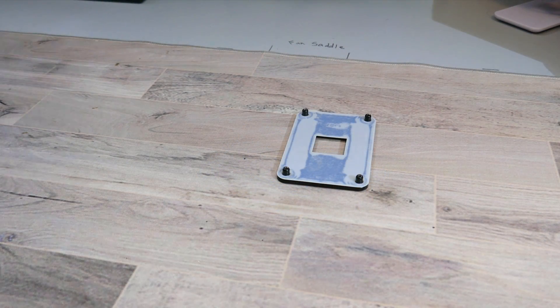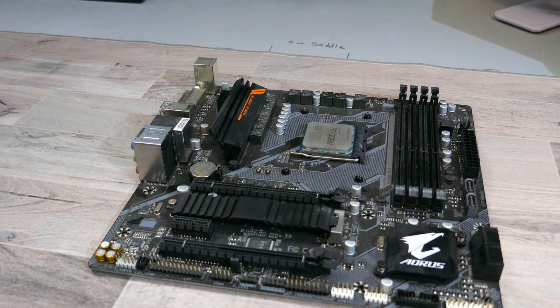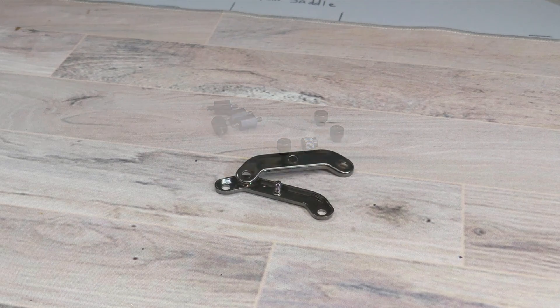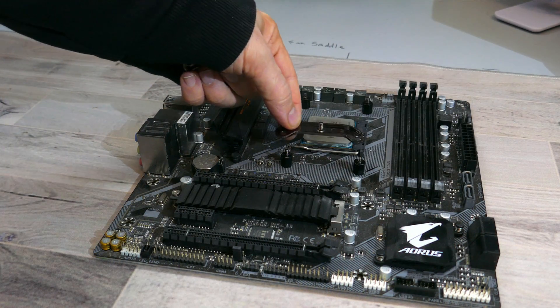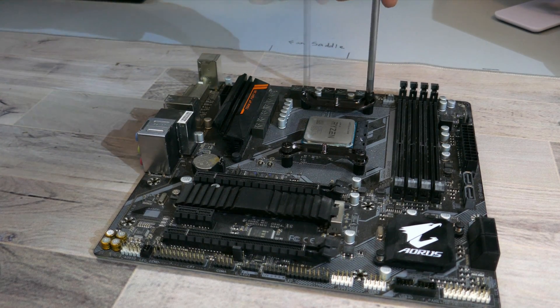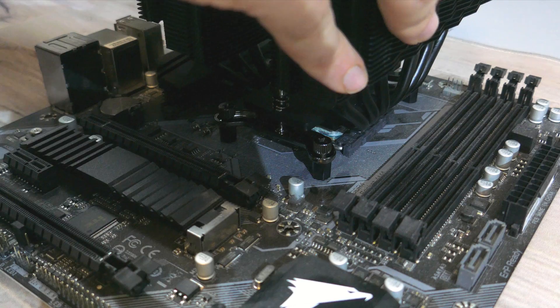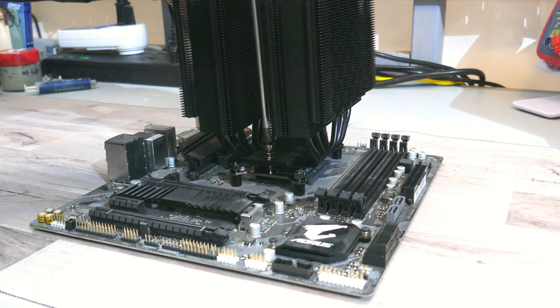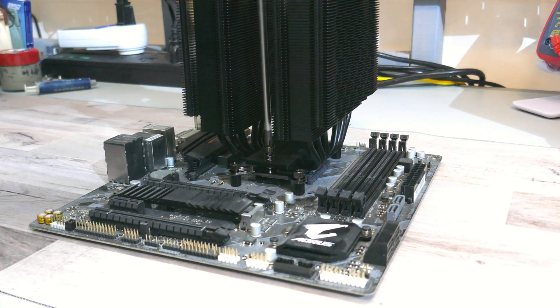With the CPU installed into the motherboard, place the backplate flat on your mat, then align the mounting holes on the motherboard to the standoffs on the backplate. Find the AMD mounting standoffs and mounting bars, screw the standoffs into the backplate, then align the holes on the AMD mounting bars to the threads on the standoffs, making sure the mounting bars are facing in. Fasten the screw caps over the mounting bars. Then clean off the CPU with isopropyl alcohol, apply thermal compound to the CPU's IHS, remove the fans from the heatsink and the sticker from the bottom of the cold plate. Place the heatsink cold plate down onto the CPU's IHS, aligning the screw threads on the mounting bars to the spring retention screws on the fastening bar, then screw in the two spring retention screws using the PH2 screwdriver.